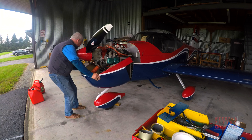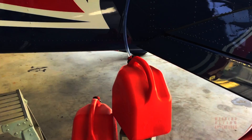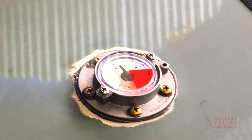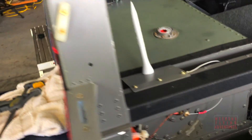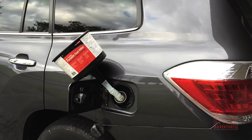The first step is to remove the tank from the aircraft, and there are a number of steps to go through. You can see me removing the cowl and getting the fuel removed. I had a full tank this time — normally you would plan ahead and leave only a few gallons at the bottom. So this involved first siphoning the fuel out, and as I siphoned it, I recycled it by putting it into my car.